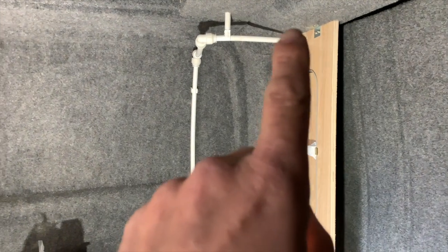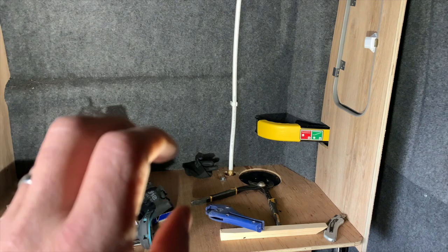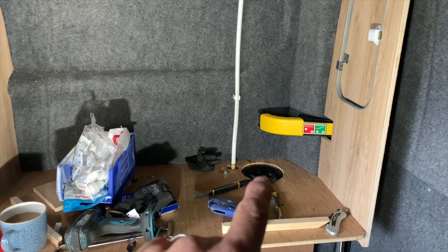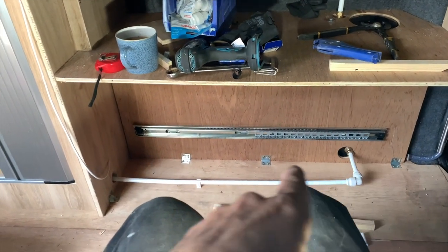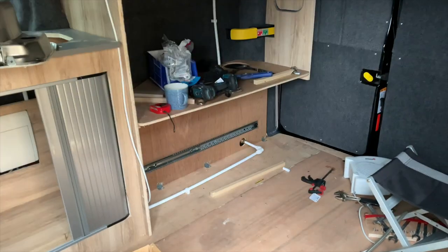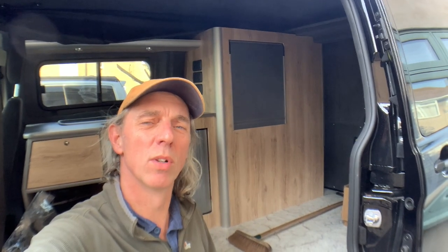Right folks, that's got that end panel in with the door in. That's the filler for the water tank - goes along there and then fills up in there. I'm going to put a bit of boxing around the bottom so that when it's got stuff shoved in the wardrobe it's not going to interfere with that little joint there. That's the inspection hole for the water tank. I've boxed all the wires in for the backs of the switches. That's one side of the drawer - obviously that's the outlet for the water tank, and that goes off to my pump which then goes to my sink.